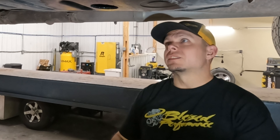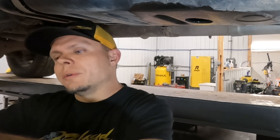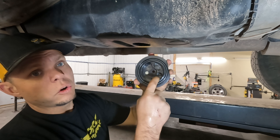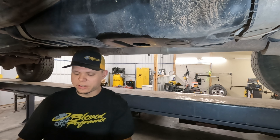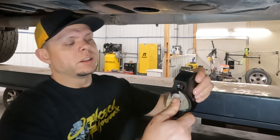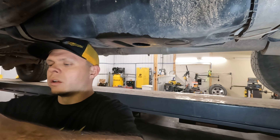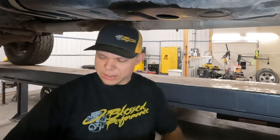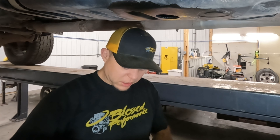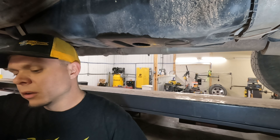It's got a FAS, which is going to catch any of that. On this truck, we've already got it all plumbed for the return to go to the factory return, so I'm not going to be reusing the return line in this equation. In this sump, the small hole is the return and the big one is the suction or the supply to the pump. You'll just take your crescent wrench and tighten this up right here. These are a barb fitting — they're not a triple barb fitting like I prefer, but they do work just fine. I still run a clamp on them just to be safe, so I do recommend a hose clamp. You can pick one up at your local AutoZone for a few bucks.